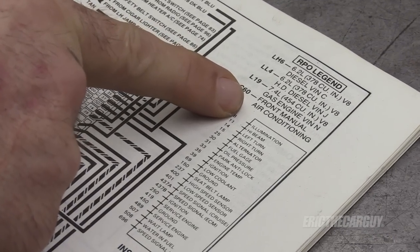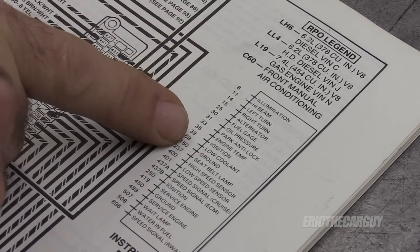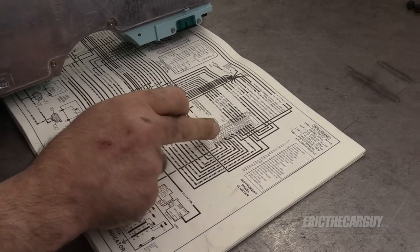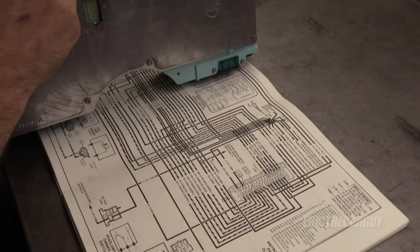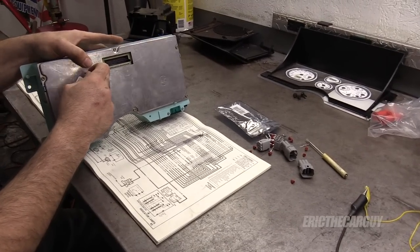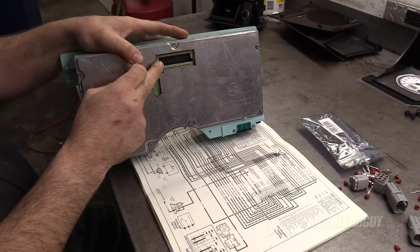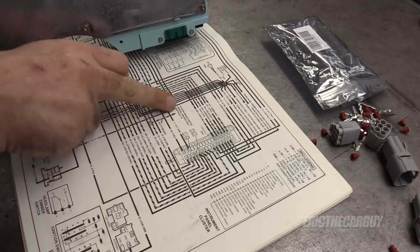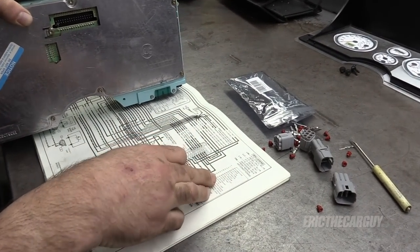What we're going to be going for is the illumination — when you turn on your headlights, you want your gauges to brighten up — as well as high beam, and the left and right turn signals. There's also a nice ground here and an ignition source coming in. So what I've done to verify the circuits before I fully commit is I've got some of these little pin connectors. These are actually for building a connector, so I'm able to go in here and actually tie into these circuits. The one I've tied into in this location is actually the ground — 150. So this one goes to this major ground up here, and we can use that ground to figure out the rest of the circuits, which are going to run power through them, like the high beam and the illumination.